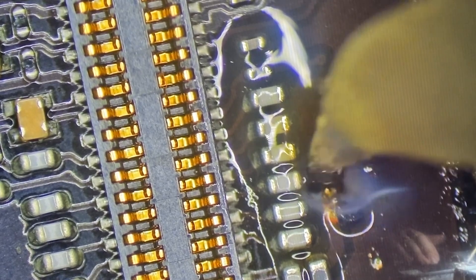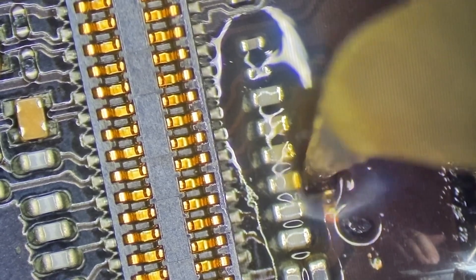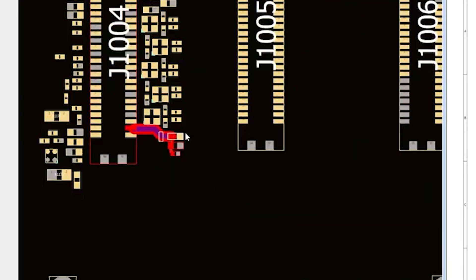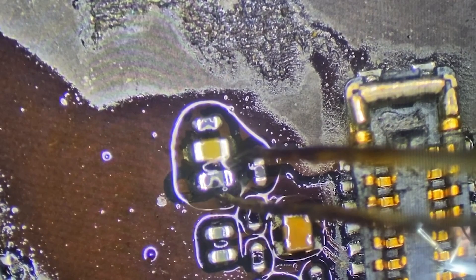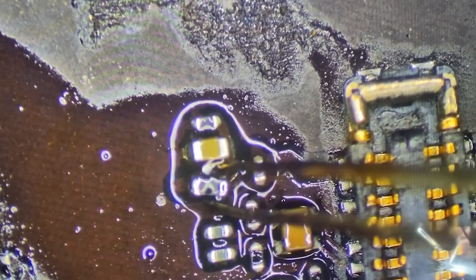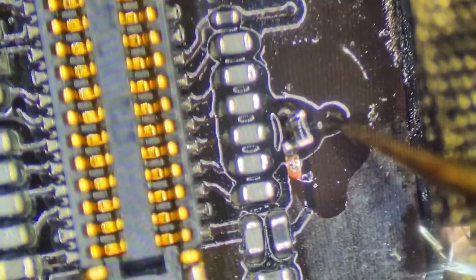Now that I've gotten it off, you can tell the pads are still not flat, but I have enough of a contact point that I can add some additional solder and solder a new filter to it. I'm going to pull another backlight filter off of a donor iPad Pro 9.7 that I have, by adding some low-melt to both sides of it to make it easier to get up. Using my tweezers and some hot air, I'm going to carefully heat it up until it wants to let go on its own, and then I can transfer it over and solder it onto the remaining pads.